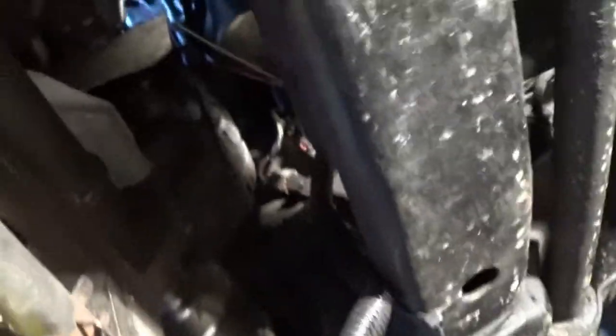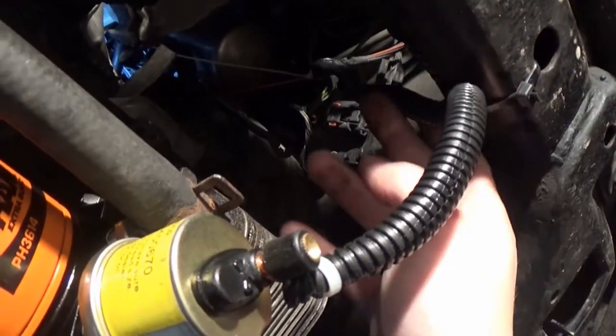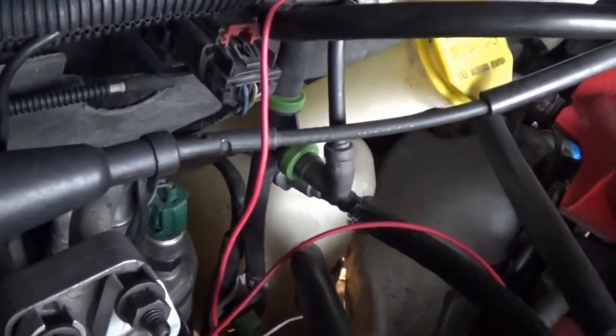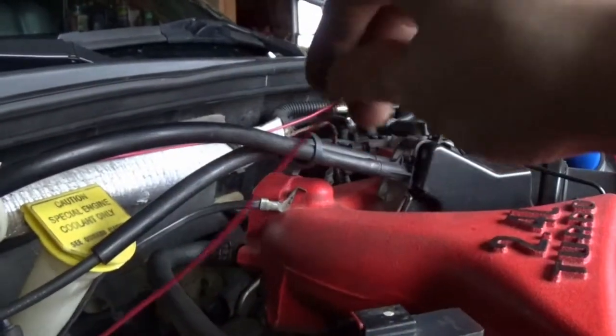I skipped ahead since it was just me reaching up in there trying to get the wire run. I got the wire hooked up and threw some wiring loom around it - cheap stuff I had from previous shenanigans. Got it zip-tied so it's out of the way of anything moving or hot, runs up in front of the AC accumulator. Now I just need to run it into the cab and throw some loom around the wires up here to make them look better and stay protected. I also noticed a ground strap wire was just dangling down in there, hooked to the side of the block but not connected to anything - if anyone knows what that goes to, please leave a comment.